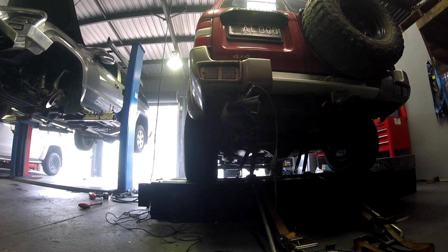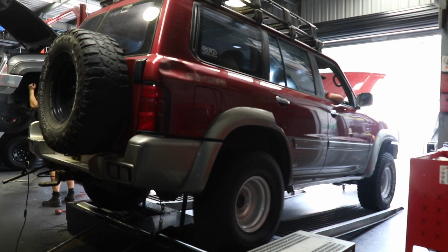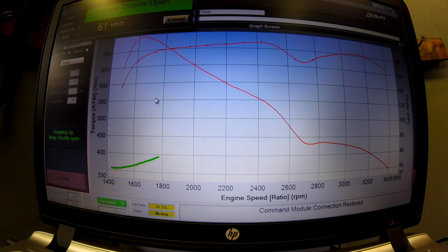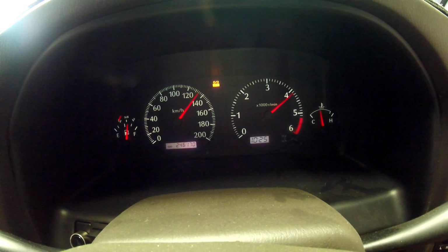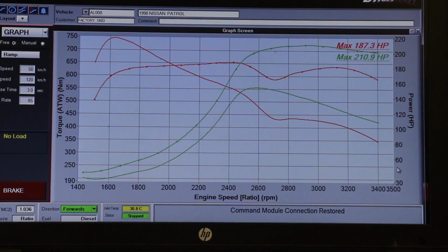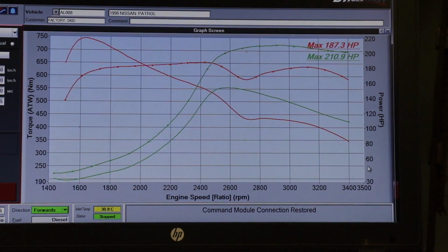It's back under the engine bay and given another turn on the fuel screw to even out the AFRs. As you can see by the amount of smoke, having the torque converter locked slows the boost response and has caused it to run very rich at low RPM. With the last dyno pull done, we made a reasonable but safe figure of 210 horsepower at 24 psi.